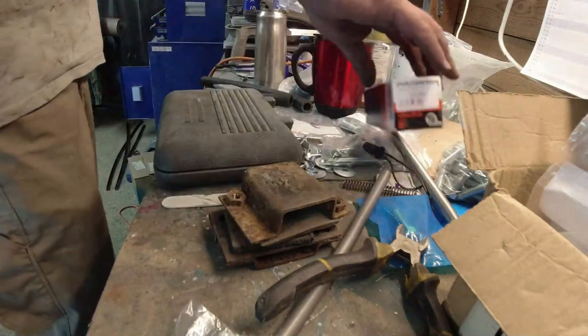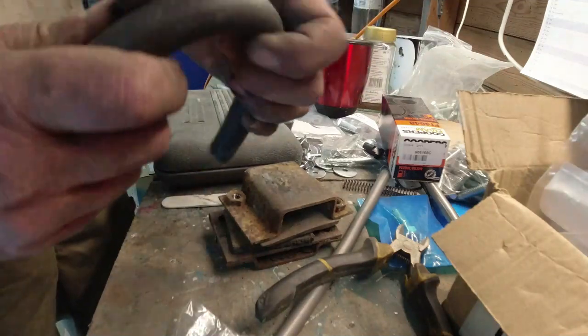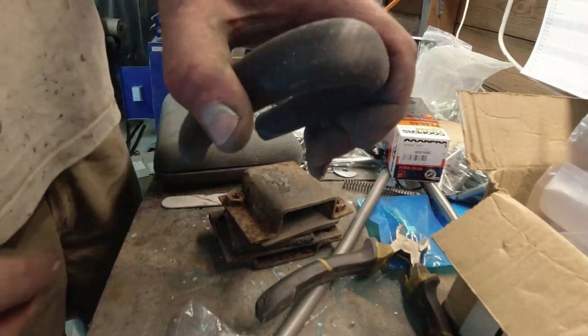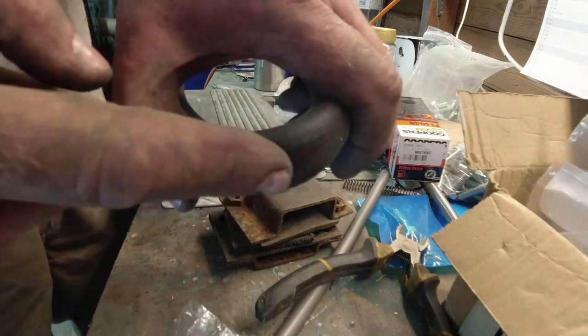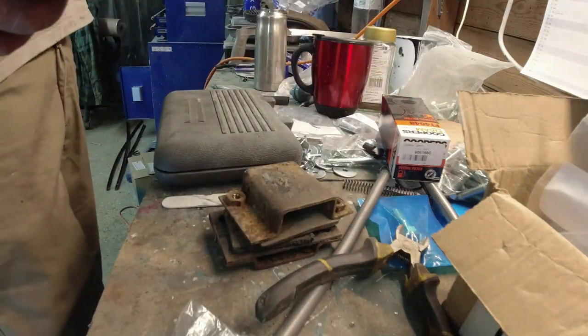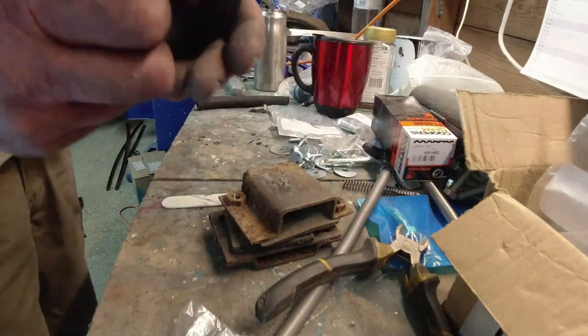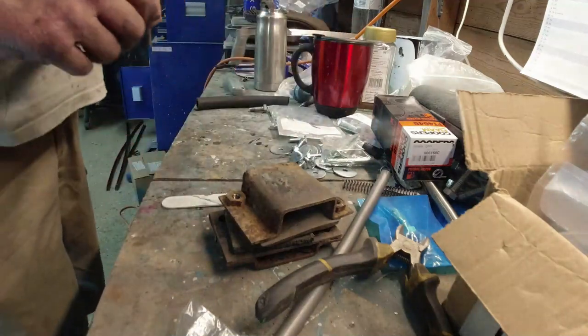7:45. I'm packing up in 2 seconds. So, the pipe that I'm using for the breather: you notice when you bend it, it collapses on the inside here. When that happens, the engine will breathe heavily and blow all of the exhaust gases, combustion gases, back down the valve guides and straight out the exhaust, causing a very, very smoky exhaust system.